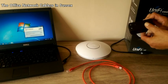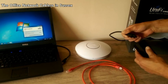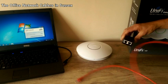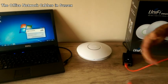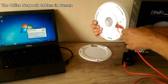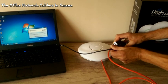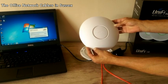Here we have the power injector and we will connect it up. It takes a cloverleaf style connector which I've already plugged into the mains at the far end — we plug that in. A little light comes on the injector to show it's on. We plug a lead into the POE side and plug the other end into the access point. Then a lead from your network into the LAN side, and as you can see the access point glows orange to say that it's receiving power.